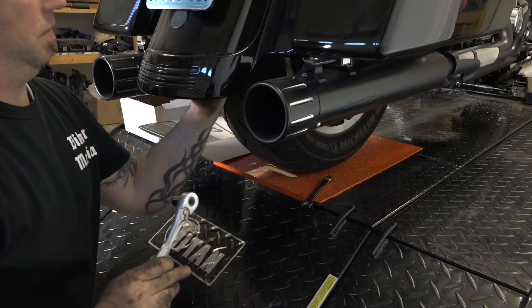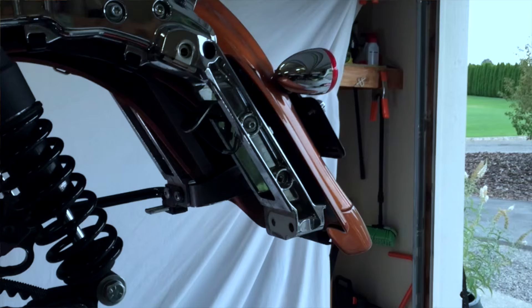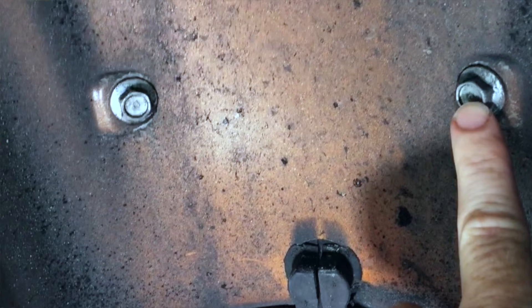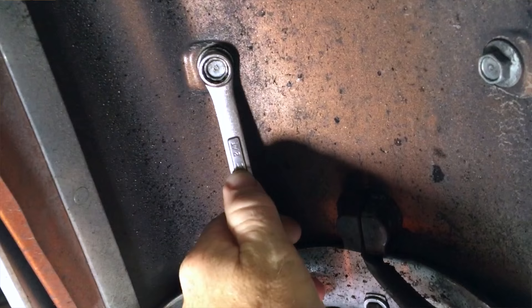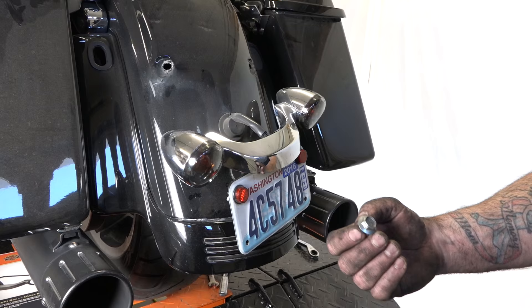So up underneath here, obviously we have a rear wheel removal video at lawabidingbiker.com/rear-wheel if you want to go that route. But we're going to show you basically what we're working on — there are two bolts back there and they're half inch. It basically secures the signals; they're kind of up at the level of the signals. You can use a half inch wrench or a socket, whatever you can get up in there, and it takes just a little bit of patience to get them unsecured from the bike.